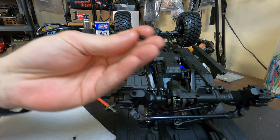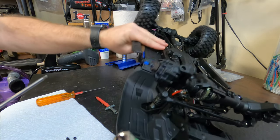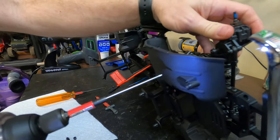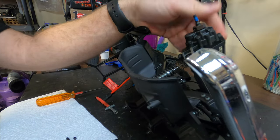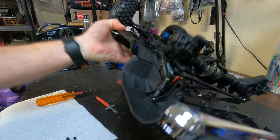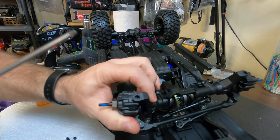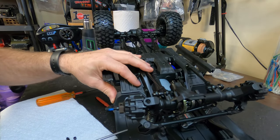Here's the other steel bushing. Okay, now we're going to take the top screws out. This might be a little bit of a hassle. Might have to take the shocks loose. We'll end up pulling the whole thing out here before we're all done with it, because we can't get in there to those top screws with these big old fenders in the way.